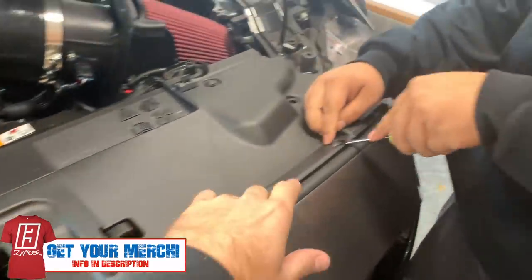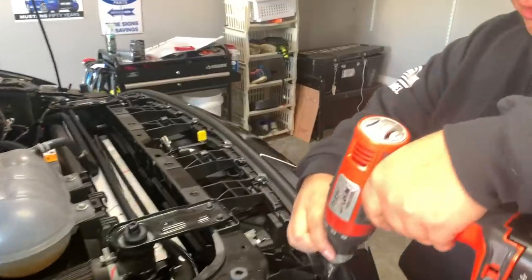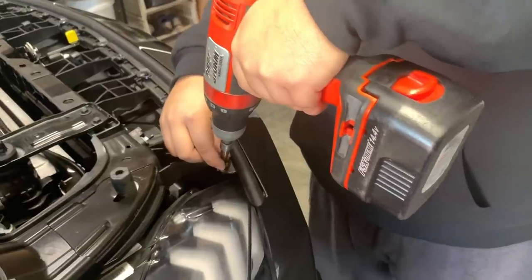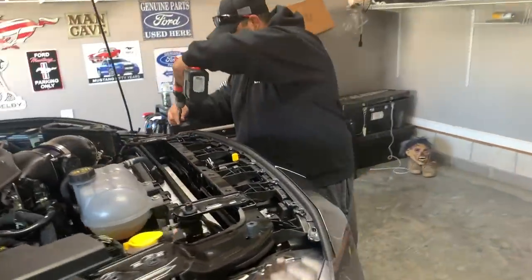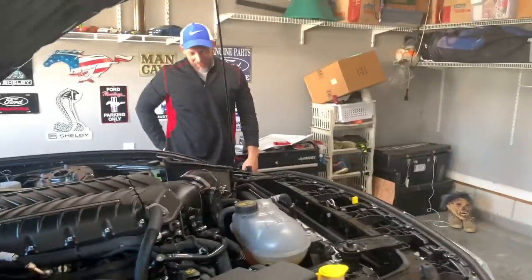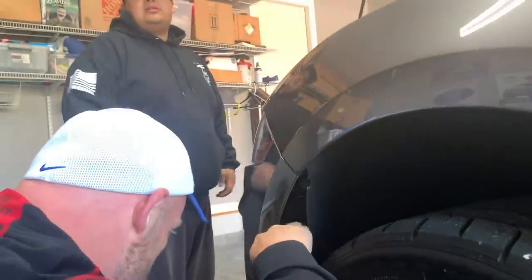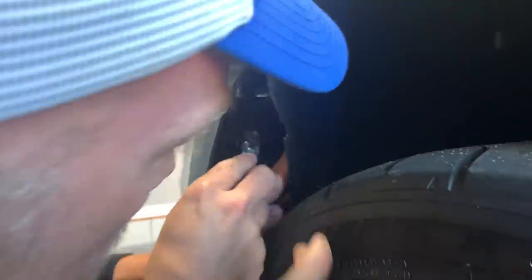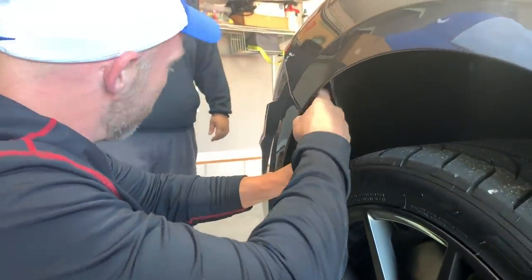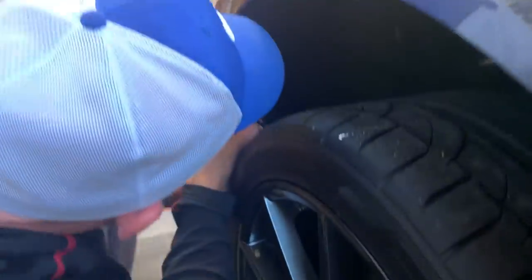Alright, so this piece has to come off. Pretty simple — just get a bunch of these push pins like he's doing right now, just don't lose them, there's a ton of them. You've got six 8mm clips and then two little 5.5mm ones at the end. The CJ video makes it look easy — they just cut out all the crap, like 30 minutes of trying to get one little 10mm bolt. Once we peel this back we'll get into it.